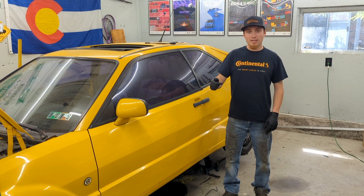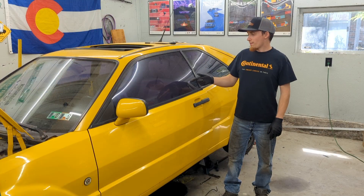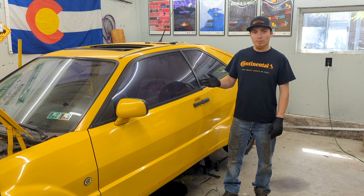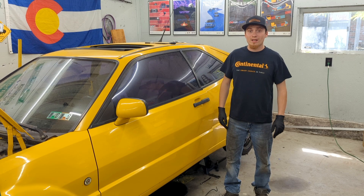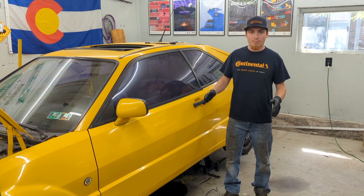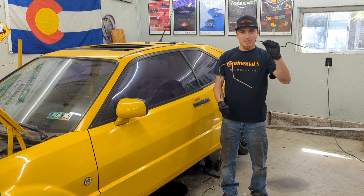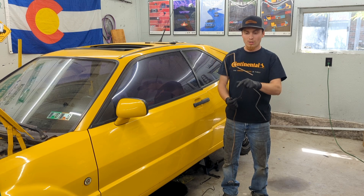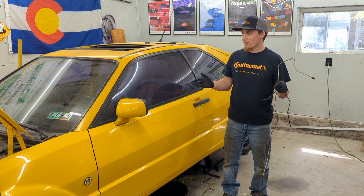The ABS unit is in the car. Turned the key on and it didn't immediately pop the fuse. For the first time since I've owned the car, I got to hear the ABS pump running — massive win. Then I hooked up VCDS to the car to see if the new ABS sensors are reading properly, but it will not connect with the car at all. My wife came out to help me bleed all the brakes and the clutch, and that's when disaster struck — as soon as she pushed the brake pedal, it immediately blew out the rear brake line. Kind of frustrating, but also a good thing because ever since I've owned the car I've never been able to get brake pressure for the rear brake, so now I know we definitely have rear pressure. The blown line sits on top of the exhaust shield, gets dirt built up, and never gets washed off — it's totally rusted through and broke clean off when I was pulling it out. Got a new line bent up and installed, and then we'll try again to bleed the brakes and hopefully drive this thing today.